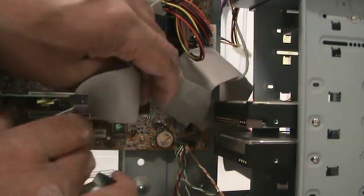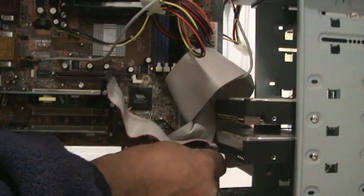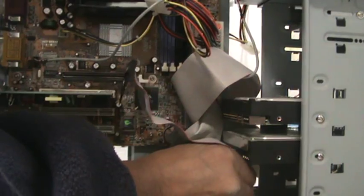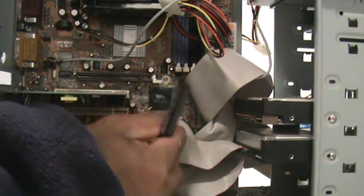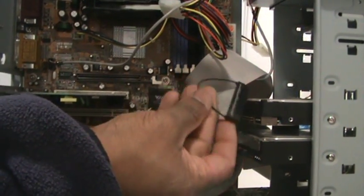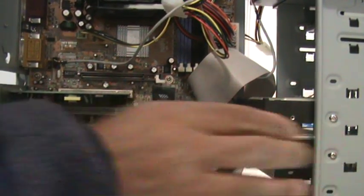Cables you moved out earlier — this is the red marked pin 1. Start off at the lowest one so it gives you room to work. Just match up with the pin 1 side and then rotate it in. Just press it gently and it's in. Please note the notch here that matches up with the notch on the hard drive. Again, pin 1 is here. Quite a few of these cables have this connector so you can pull them out easily. Again, just match up with pin 1 and just gently push it in. There you go. Hard drive done.